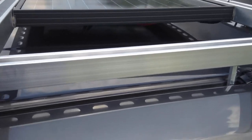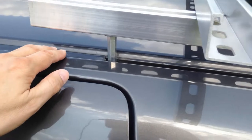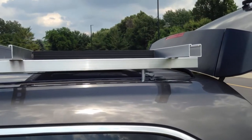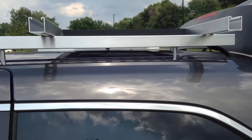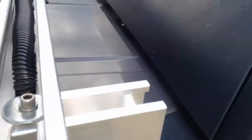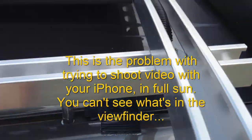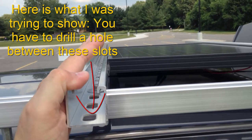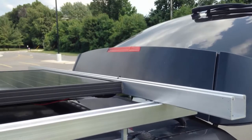One of the things I found when building this is that these roof rails are not parallel — the channels cut into the roof get closer together as you get to the back. So if you want to mount the panel toward the back of the vehicle like I did, you have to improvise because the slots are not all going to line up. What I ended up having to do is drill a hole back here in order to get everything to line up properly, to get the same amount of overhang on both sides and get it as far back on the roof as I wanted.